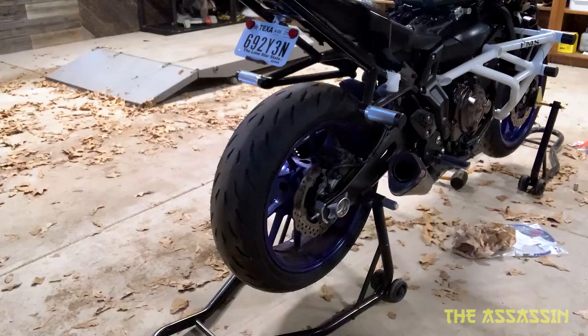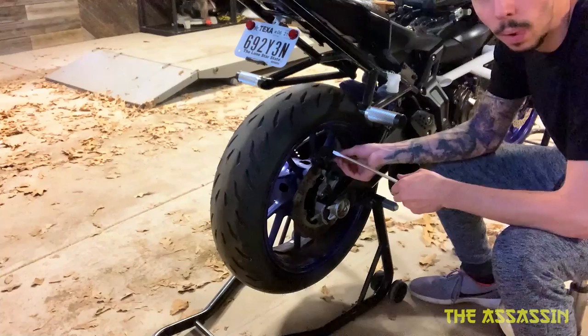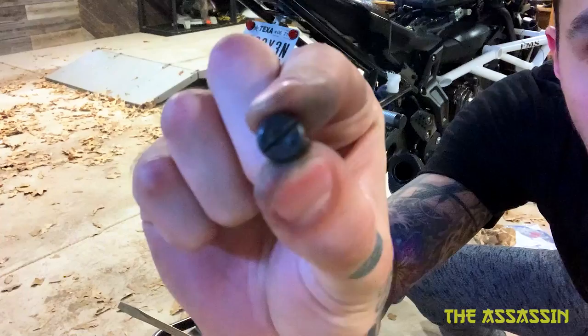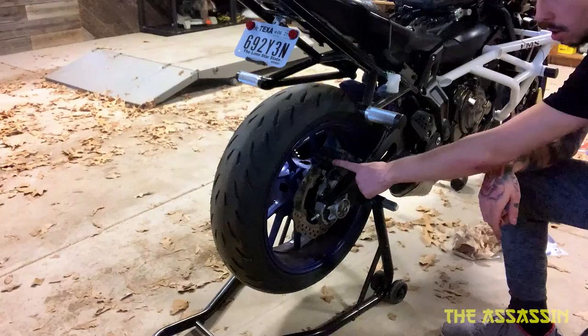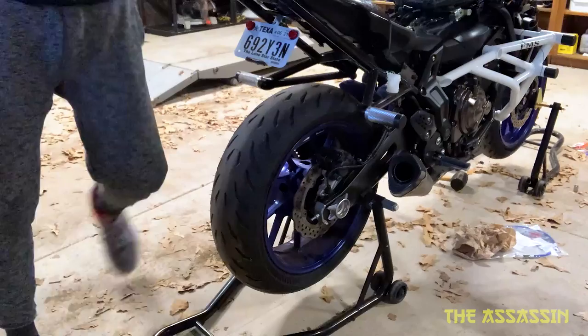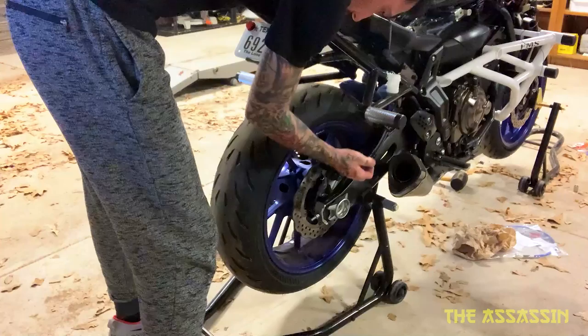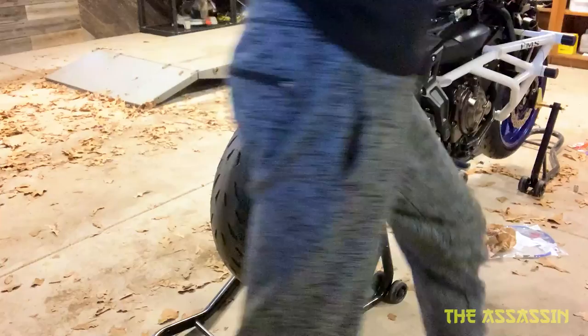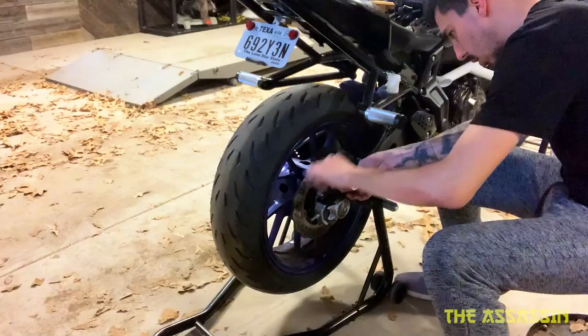From what I learned you have to bear into the rear caliper because there's a little safety thing on the brake caliper. You gotta press into it so you don't strip it. There's also an Allen key bolt — this little bolt is a 5 millimeter and my 5 millimeter is jacked. Don't take it all the way out because this bolt holds your brakes. Loosen it a little bit. This one's a 6 millimeter and it's easy. That's loose — okay.